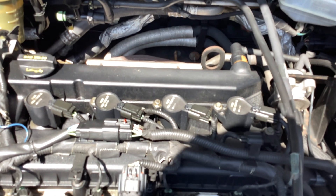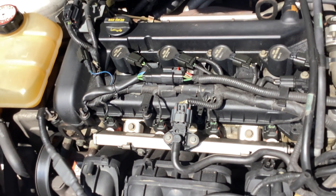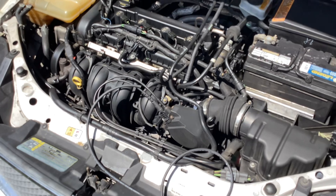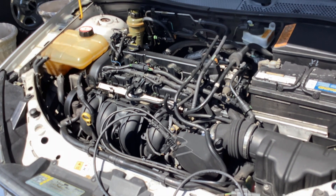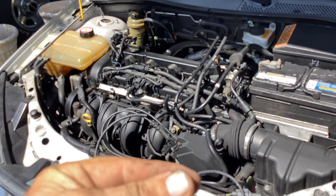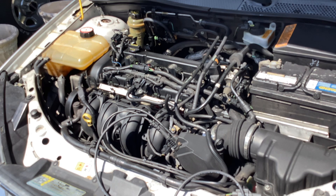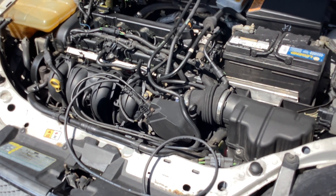Group five, FMXV 02.01GB is the engine group. That's all I got — have a good day, thanks for coming out. We'll get back to mowers in a couple minutes, this was just a quickie. Also, the other issue was the door handle — I bought a driver's side door handle because the door wouldn't open from outside. I took off the whole panel and it was just a little metal rod that came off a clip, so I re-clipped it and we got action on the door — didn't need the handle. Got lucky there. It'll cost more to send it back than it's worth. Have a good day, tip your wait staff — they're doing an awesome job and they depend on your generosity.